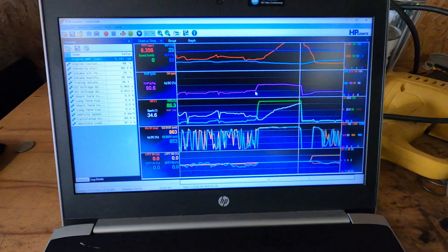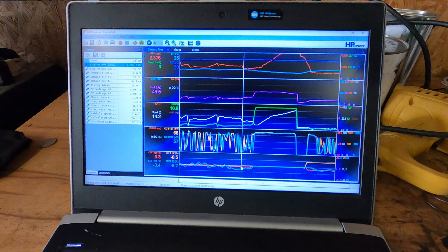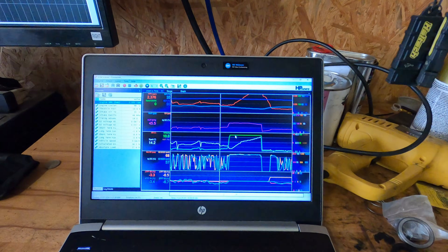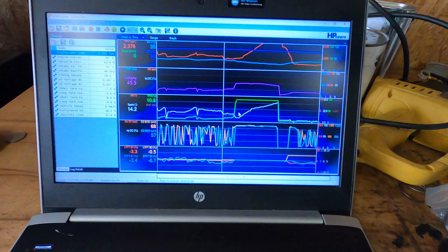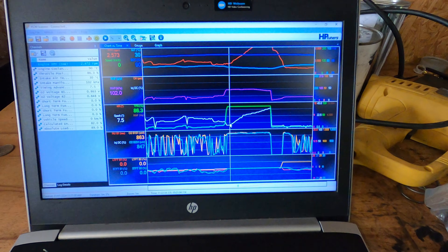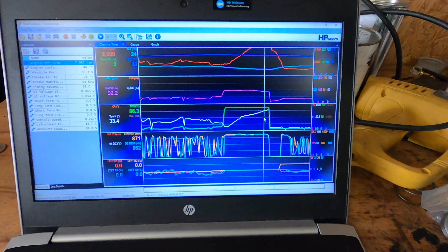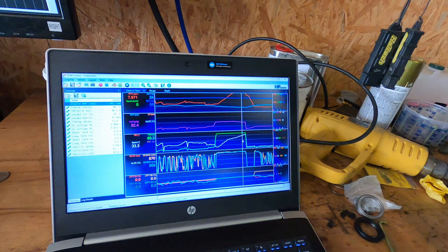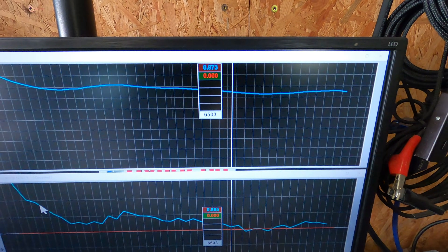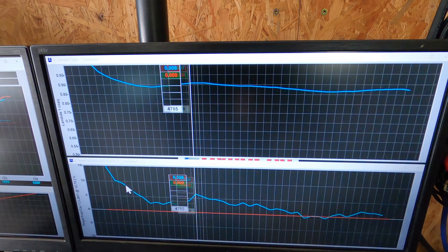All in all, that gives me more data. The next thing is to get into the ECU and see when we can map it. I reckon this timing here is a global timing map for your 95 fuel, so I dare say you could put a couple more degrees timing in here and get some gains running 98. The fueling — if you have a look here, that's in lambda: 0.87 lambda, 0.86 lambda. That's bang on the money for making power. Perfect.